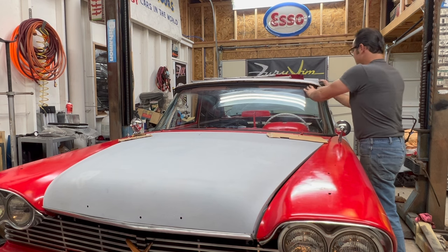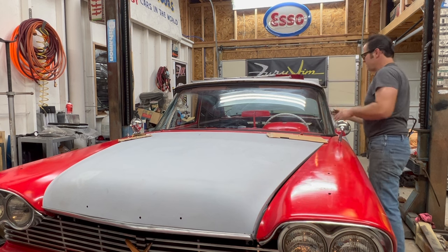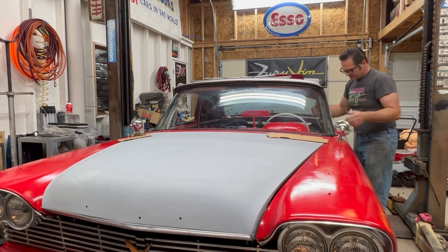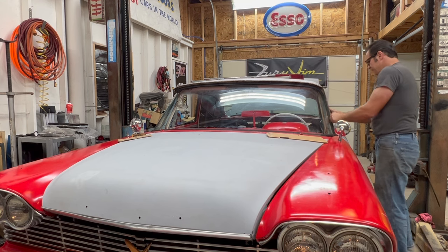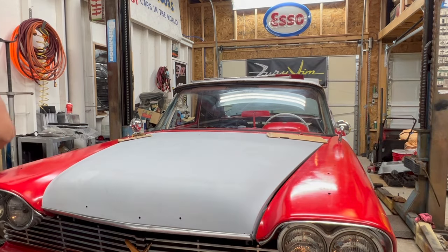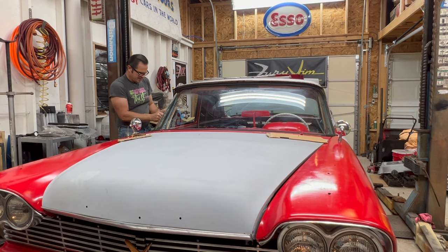Start locking in at the top. A few inches there. Now see if it needs any fore or aft movement. You can rock the car with it. Again, you could almost lift the car from the glass, you won't hurt it. And then lock this side in because it seems pretty balanced. And then lock the passenger side.